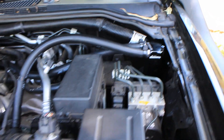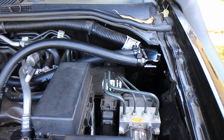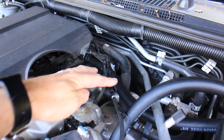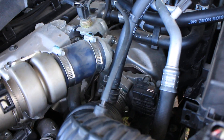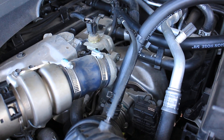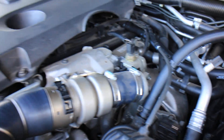Welcome back to my new YouTube channel. This video is about oil catch cans — what they do and how I've installed mine. What an oil catch can does is it takes the crankcase ventilation, which is coming from here and would traditionally go back into the inlet down here, which is the air intake pipe to the turbo. For a long time, diesels have breathed back into the air intake without a problem — the oil just goes back through the inlet manifold, gets burnt up, and doesn't cause much issue. But with late model engines and the introduction of exhaust gas recirculators, or EGRs, things change.